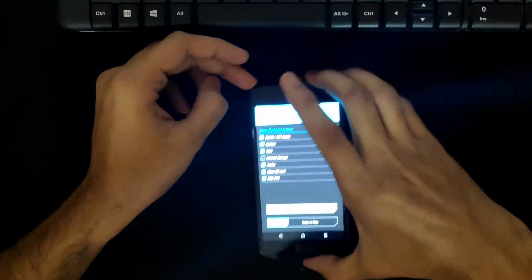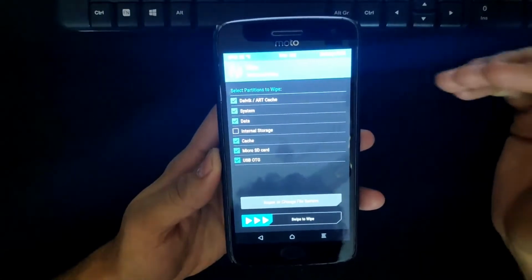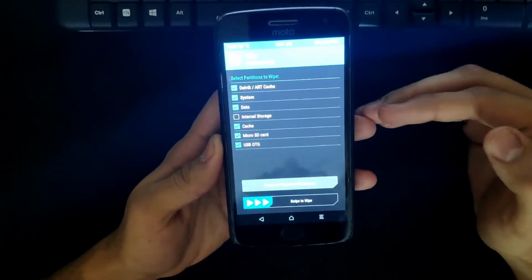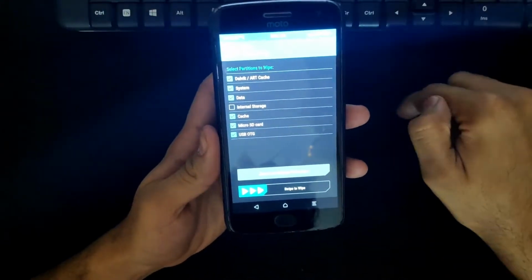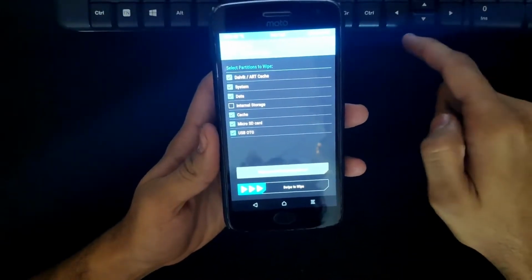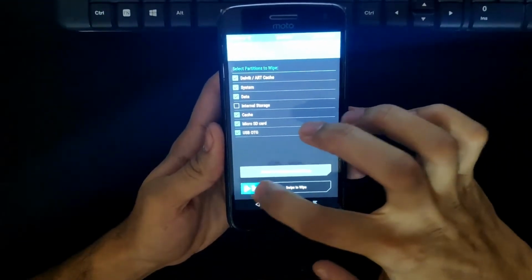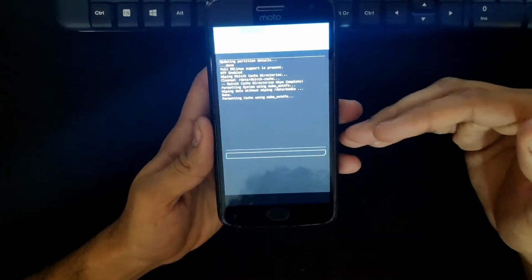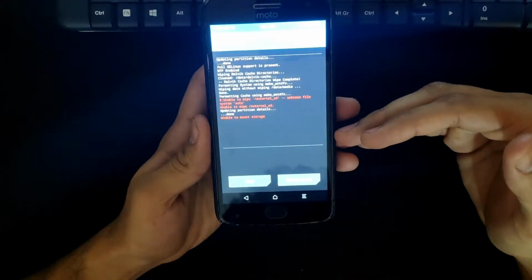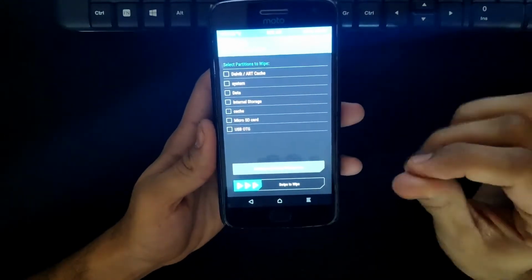So you gotta select all this stuff except for the internal storage, because we have the flash ROM copied in the internal storage here, which you can find in the link given in the description down below. You have to download that file onto your PC and then transfer it to your internal storage. Then you gotta swipe to wipe your data. So now the data is being wiped on this phone. Yeah, wipe should be complete.